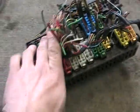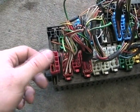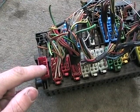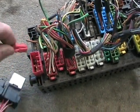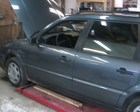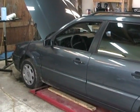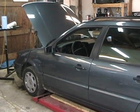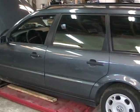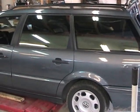The other nice thing about this electrical system is that, for example, vehicle speed, the interior lights, and all those other little things that lots of things need to plug into — there are these little bus bars with multiple connections on it. You can click them in. So if I was to retrofit heated seats to this Passat, I would have three connections: a ground plug-in, a switched power plug-in, and a dashboard illumination plug-in for the backlight on the switch. No wires would have to be cut. The harness is its own separate harness and it's very easy to move. I pulled one of these out of one of these cars in a junkyard in 15 minutes, having never done it before.